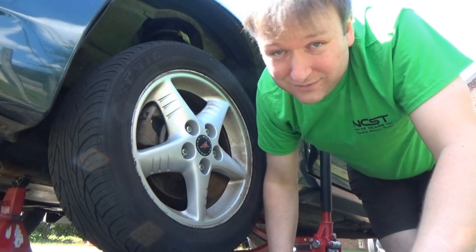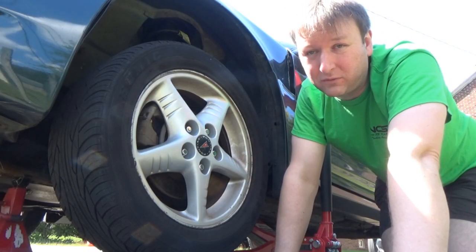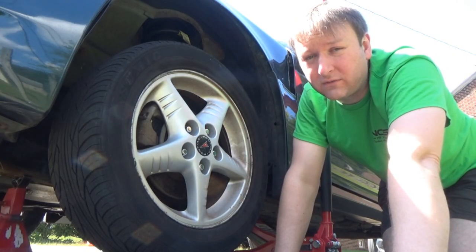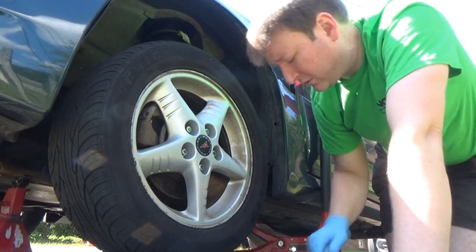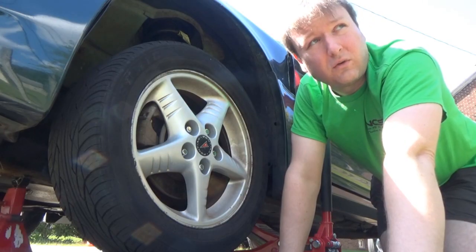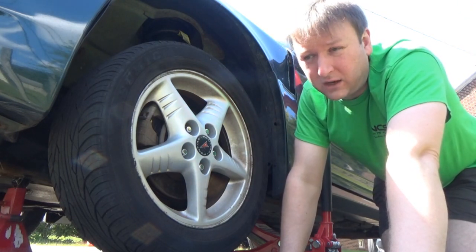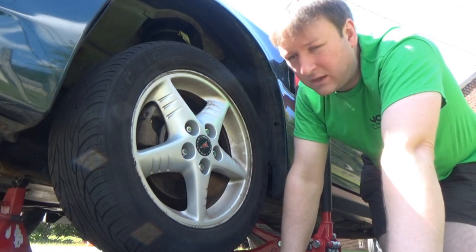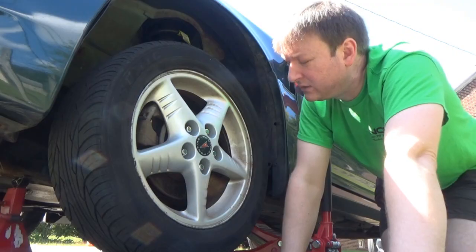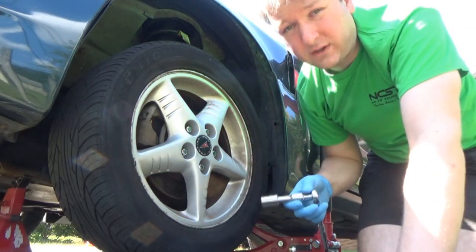But this car is for experimentation. So even if it doesn't work, there's still the possibility of replacing a sensor or a hub. So it really doesn't matter to me at this point, but I am kind of curious to see if we can fix it by just splicing in another connector. This is also going to depend on how badly corroded the wire is. There's not much wire to cut, so we have to be very careful. But if we do cut off a nice small portion of wire, and we see that there's not a bunch of corrosion under the insulation, then maybe there's a possibility that we could save it. Again, I didn't really feel like bringing up the loud electric gun, so we're just gonna do this.